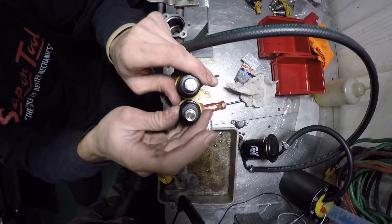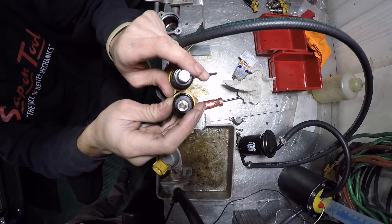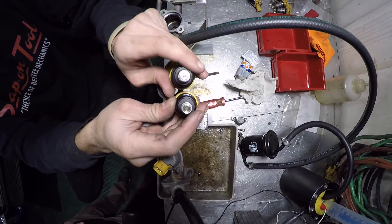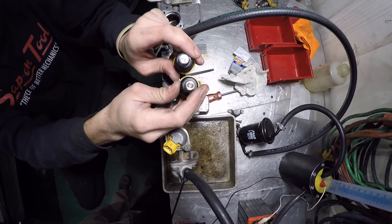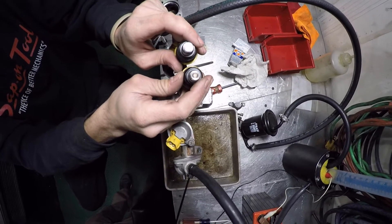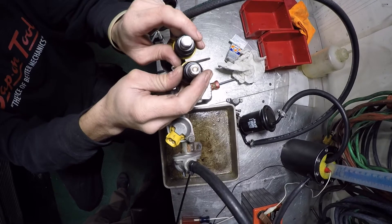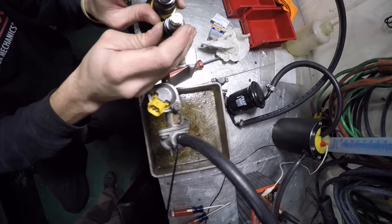So explain the difference here. Factory. Decapped. A bunch of little perforated holes regulate flow. You take off that cap and it'll flow more. Atomization is worse, but I'm cheap, so I don't care. Atomization — tiny droplets, fine mist. Like a spray bottle versus a jet stream on a garden hose.